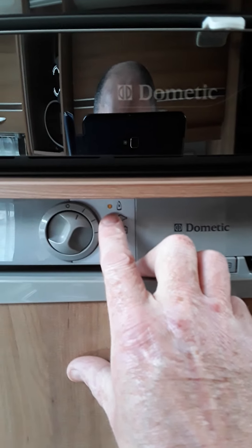Over this side here you have your temperature control. And then you have your fridge catch here - it opens that way. It's got two wee recesses on it. The first one you can use to vent the door - close it in that position and it'll leave a gap all around the door to let air in when you're not using the fridge. The back one is for normal locking. Always have the catch facing that way before you close the door so you don't damage it, and then over and locked.